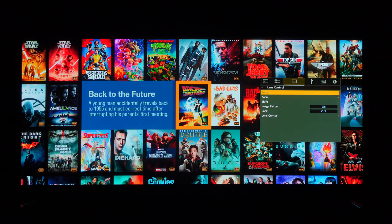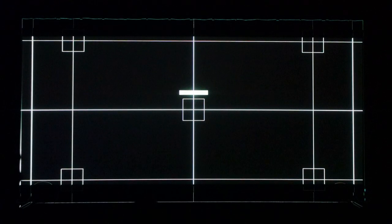You use the projection and lens control adjustments within the projector to manage squaring up the layout on the screen. I'm shooting a JVC NX7 from about 18 feet back to fill a 150-inch wide scope screen. The key steps: get everything squared, boxes lined up on left, right, top, and bottom; do your tilt, yaw, adjust your feet on a shelf, or your mount on a ceiling. Not always 100% feasible — not every wall is perfectly square, and with a large screen you might still be a little off.